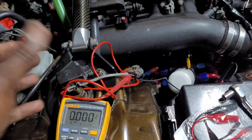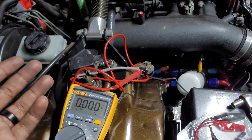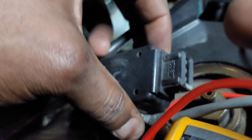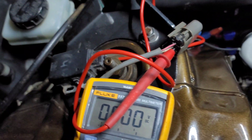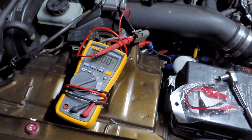At idle or resting, you want 0.4 to 0.5 volts, and the one you want to check is the center — the middle pin. On this white connector, check the middle one. I think the other connector here is a dummy connector. This main one is the one that supplies the voltage and senses the signal from the throttle position sensor.